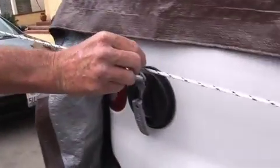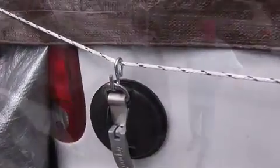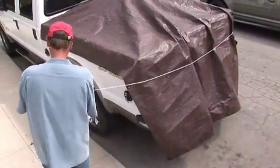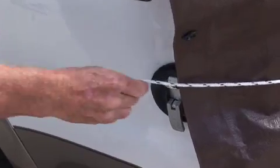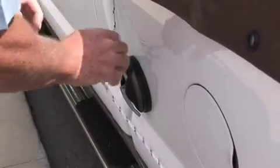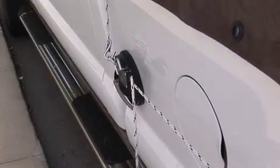Again, slide the next hook into place to attach it to that tie pod. Work your way around the back of the vehicle keeping the rope reasonably taut, and then attach it to the remaining tie pod in the same fashion. Then pull the rope to the front of the vehicle, place the hook of the ratchet device into the ring of the first tie pod, and pull to gently secure the rope in place.